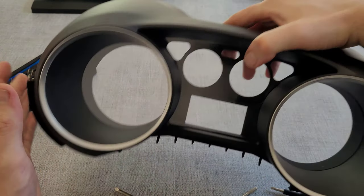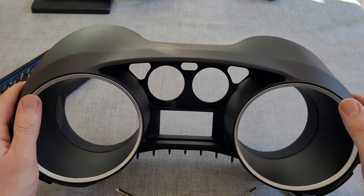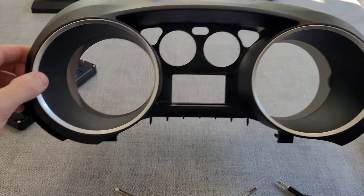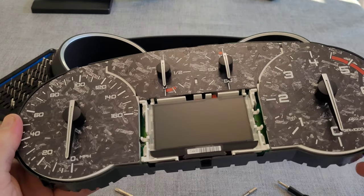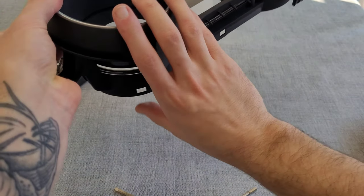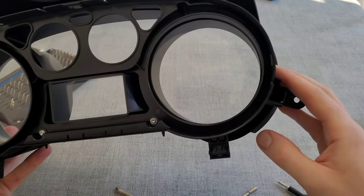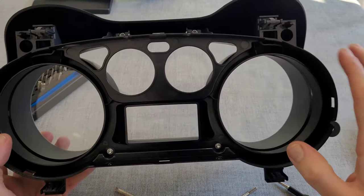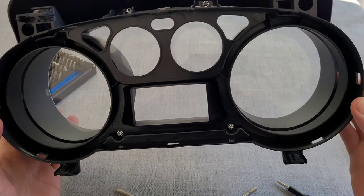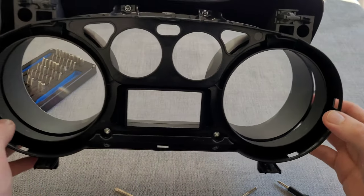So we're up to there, still got the lenses in. If this is all you wanted to do - you've broken this or you just want to replace this part with the lenses - that's where you stop. Or if you want to mess around with your cards you can carry on, but that's a whole other video. Now to get to those bottom two screws you've got the six you can see from the top, then these two. That's how you get to the back - your lenses. Clean them - I'm not sure what to suggest, I think it's quite delicate plastic, I'd probably Google that.